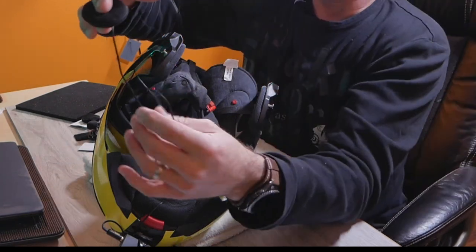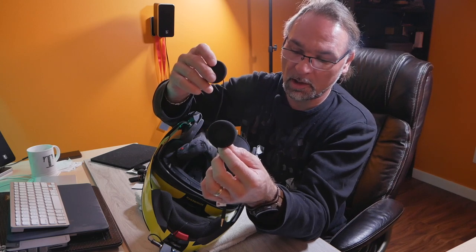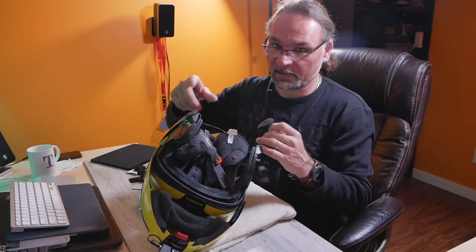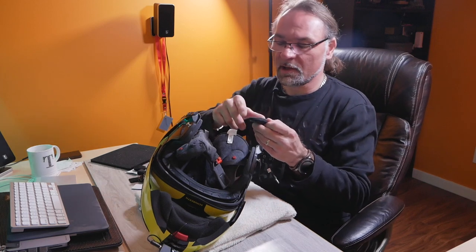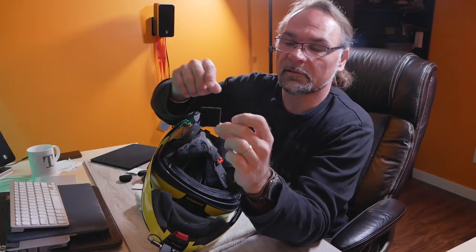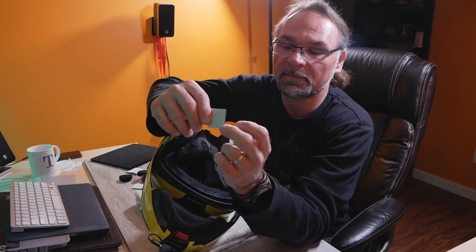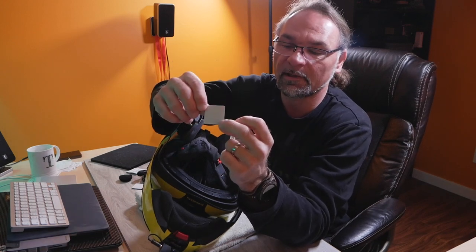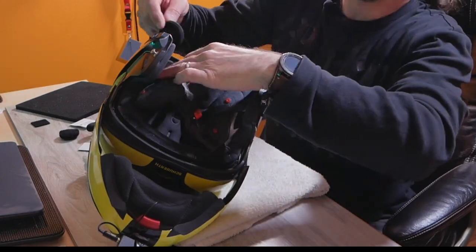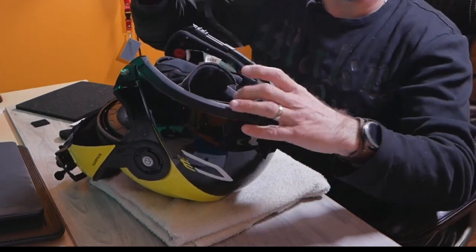Keep in mind that on the speakers, one wire is longer and one is shorter. The shorter side obviously goes on the same side as the comm system, which is the left side. You don't want to put it on the right side because that's your throttle control — you want left-hand access to the comm system. Start with the velcro pads provided; clean the surface with alcohol first, then stick on your velcro and the speakers attach to this.